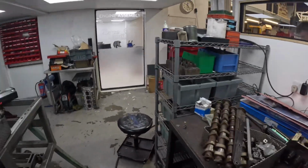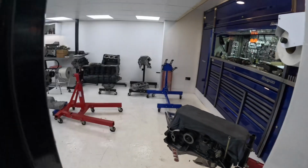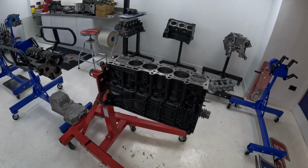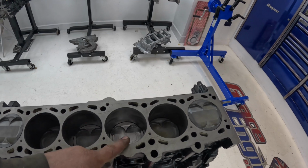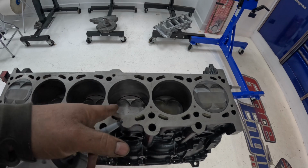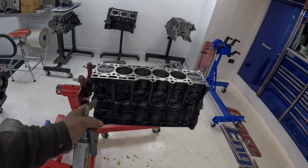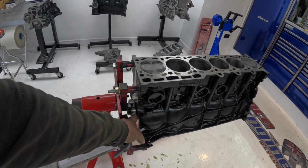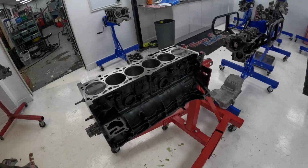And on the block, which I'll show you, the block just came in for crankshaft polish, new rings, hone, block skim. We've given it a coat of paint just to make it look nice, and then it had some damage on this piston which he didn't want replacing, so I've taken all the burrs out of it and polished it as best I can get it. That's all together now, so all I've got to do is put the bore squirters in it and fit the rear oil seal housing, bag it up, and then it's ready for my customer to have back.